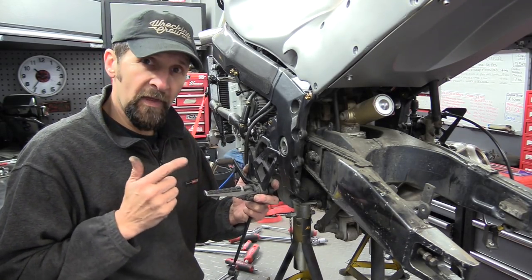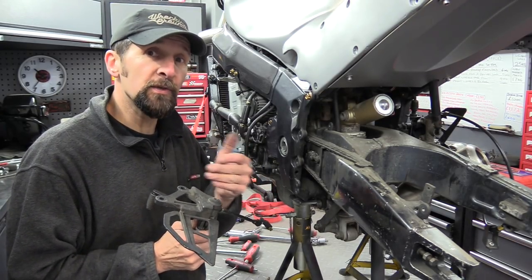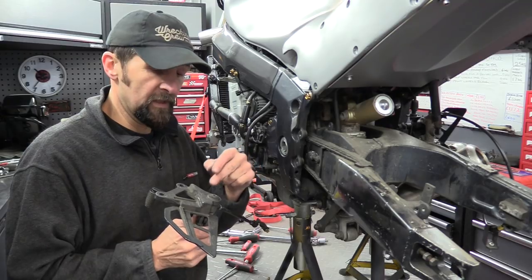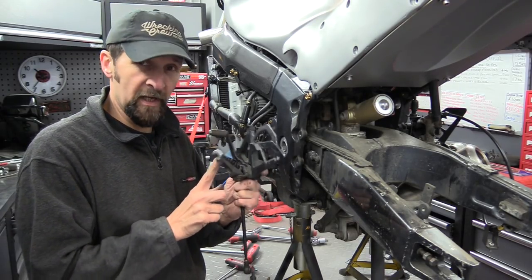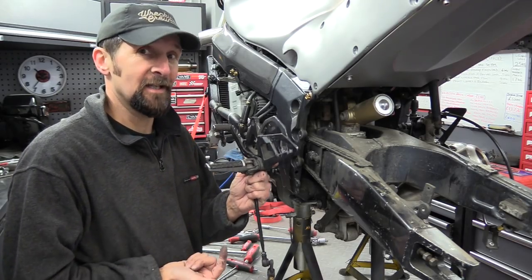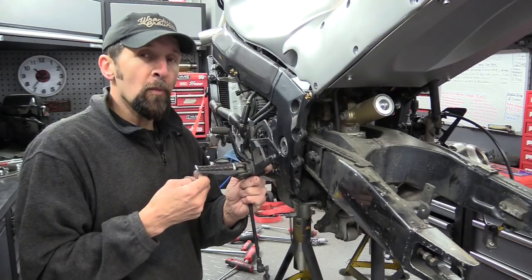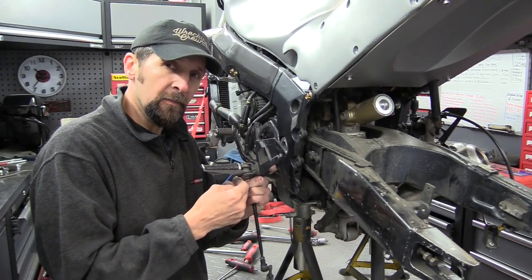Well, that would work, but on this particular bike, in the back here, there's a single-sided keyway, so they don't go any other way up than that, they only go that way. But if your foot pegs can be spun over so that they face downwards, you can effectively put your axle stands under them, preferably towards the inside where they're going to be stronger.